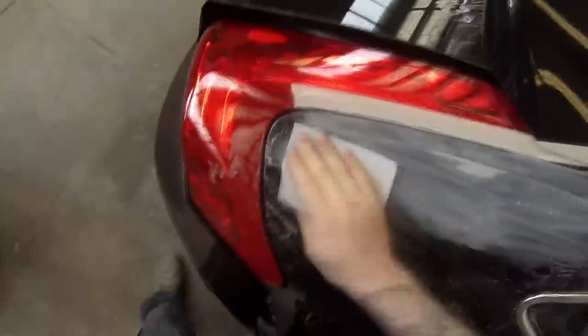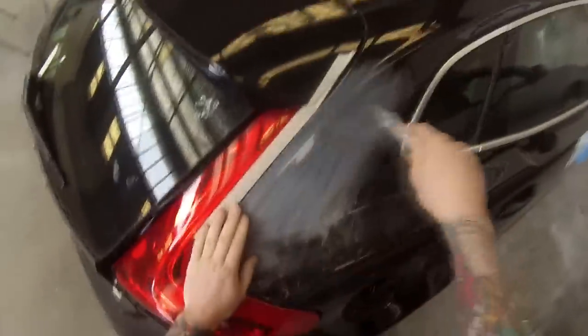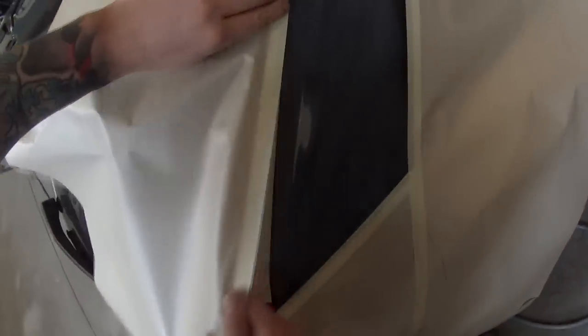For this job I just decided to use some 1K primer. What I'm doing here is going around all those edges with a 500 grit soft sanding sponge — I don't want to finish that off too coarse. If a panel beater had done it maybe they would have gone with 120 or 80 grit and it would need two pack primer to fill those deep scratches. But we work in a very busy workshop with goals to meet, so the quickest way was just a thin coat of 1K — just a quick dust coat and then a slightly wetter coat.